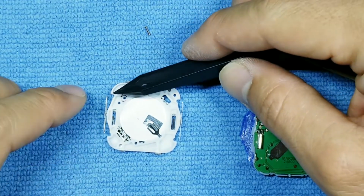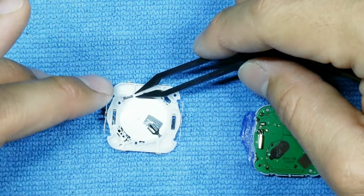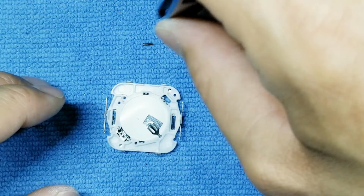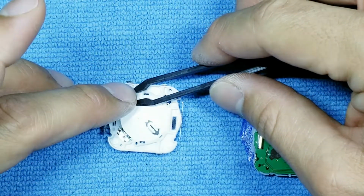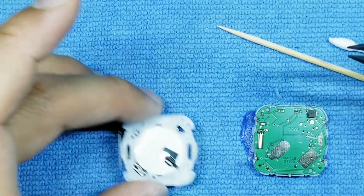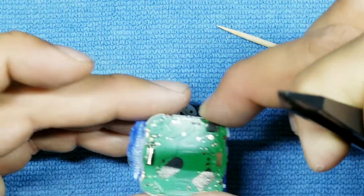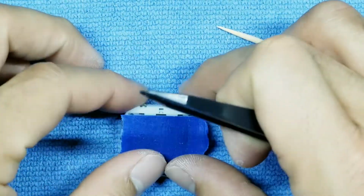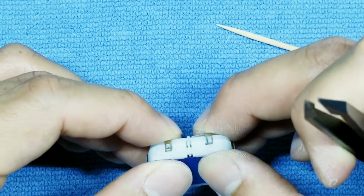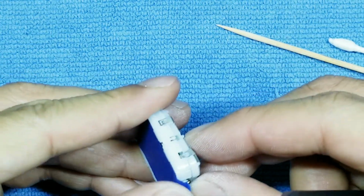Go to that Sharpie hole that you marked and insert your spring. And make sure that's flush. Go ahead and keep that part down. Take this part, flip it over, and push down, lift up, and go ahead and reconnect our contacts that we pried off at the very beginning.